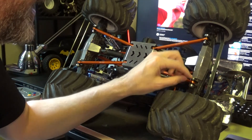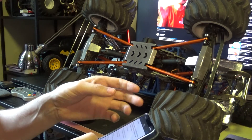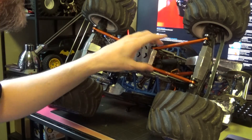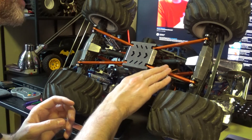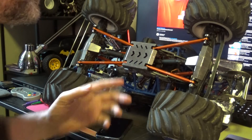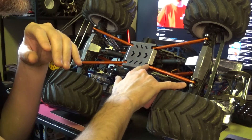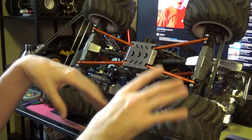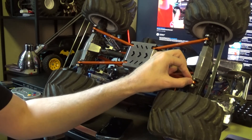Now let's look at the links. These are big and beefy — the ends are aluminum, slightly bigger diameter than stock. They're 6061 aluminum with an anodized coating. I chose orange to match my other monster truck; orange and blue look good together. They look great and won't ovalize at the ends, which is the big problem with stock links. However, they are terrible to install — kind of a nightmare — because of the very sharp angle they have to connect at due to the narrow center. And unlike plastic links, these won't flex when you install them.